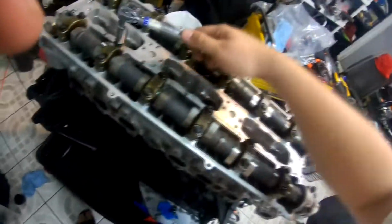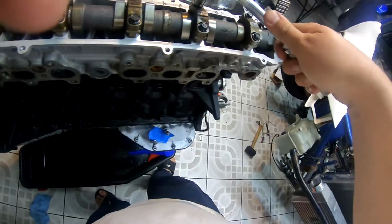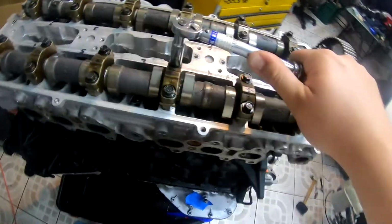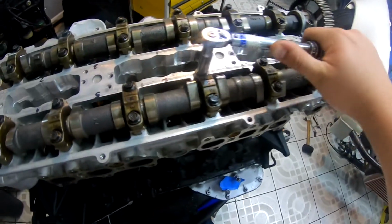What we're doing is working from the center out. I'm not torqued yet, but I'm progressively tightening them some more to make sure nothing is being tightened down before everything else is at the same spot. We're going to torque this one. You'll see the torque wrench break there. Okay. Torque.